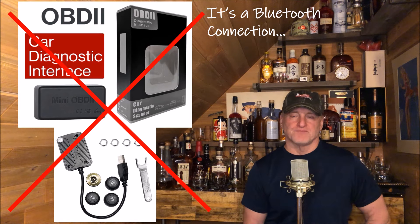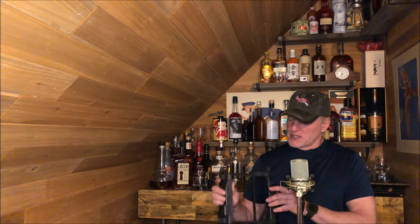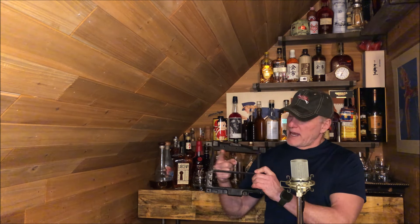One of the ways I made this much easier was to go to a junkyard and get the sub dash out of a wrecked F-150. You have to watch for something I'll mention later to make sure you get the right one — I didn't get the right one the first time. The nice thing about getting a junkyard sub dash is you can do a bench grind-out; you don't have to do this in the vehicle, which makes a mess. You can grind out the top section here to get the double DIN unit to fit perfectly on your bench, without all those shavings falling down inside the vehicle that would have to be vacuumed out and could cause problems later on.